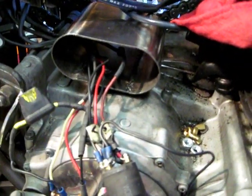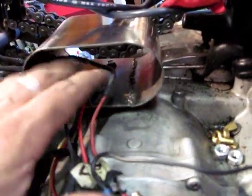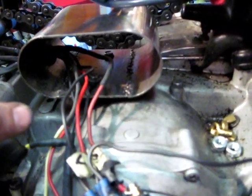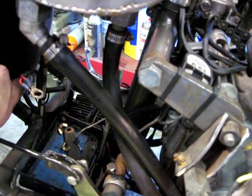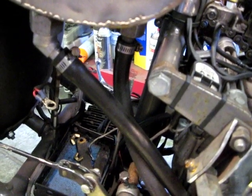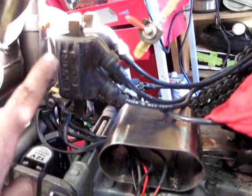That's how I use my oval electric boxes — there's not a whole lot of extra room in there for extra stuff such as a solenoid. I keep these small for the minimalist. If you want to run a starter, you would run the power lead in here to ignition, then hide your starter solenoid up underneath your seat pan or somewhere else out of the way. I usually put my regulated rectifiers hidden down by the battery, or sometimes mounted on the front face of my fender, or even underneath the seat. The regulated rectifier needs air to keep cool — a lot of guys used to put them inside the old Santee or Finch boxes but they burn up from overheating. Same thing with your coils — your coils go outside. I like to use the Dyna coils.